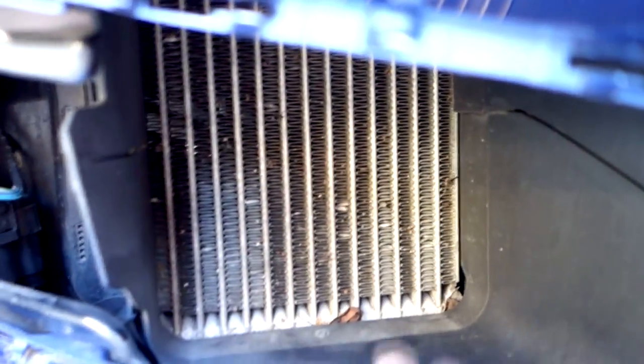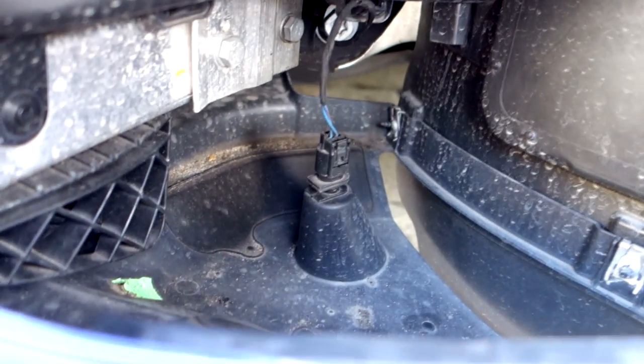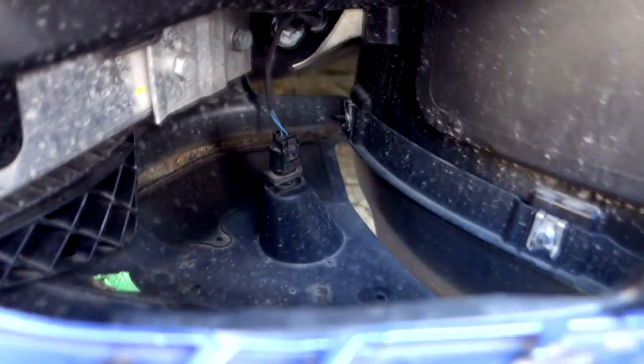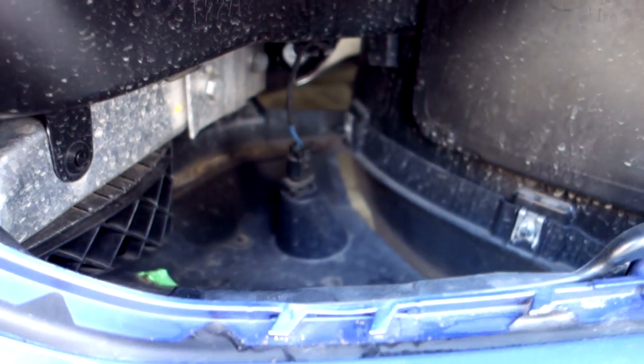Having a quick look inside the air dam, you can see we've got the oil cooler on this side. Moving over to the other side, there's nothing there — which is why this plate is normally blank on that side. Down here there's a little sensor, and I was wondering what that was. I called up my friend Brian from Keyes Motorsport — you might have seen his videos on YouTube, he's been a great inspiration for a lot of the videos I've done — and he told me that is the outside air temperature sensor, so no need to worry about that. There's quite a bit of water spatter in there already from the brake duct, so I'm not too worried about the extra water that might get in from the front, but if you are worried you can always wrap it up with a little bit of electrical tape.